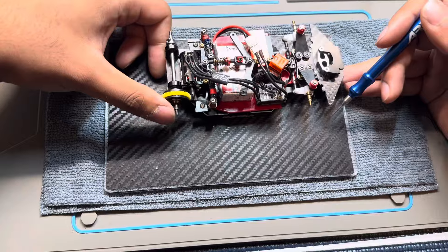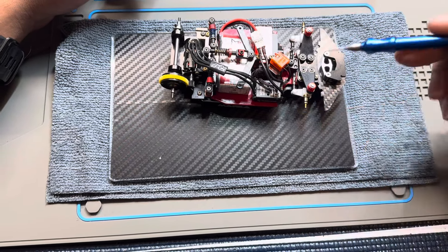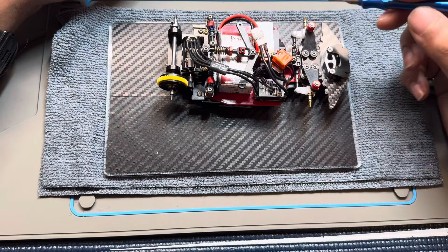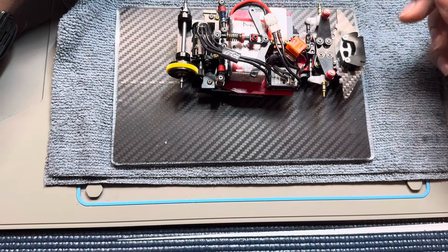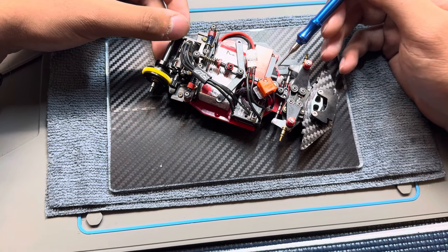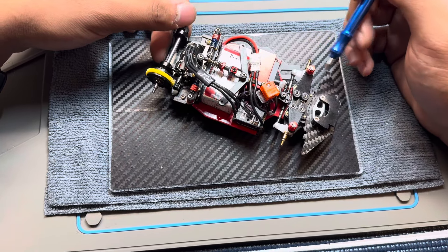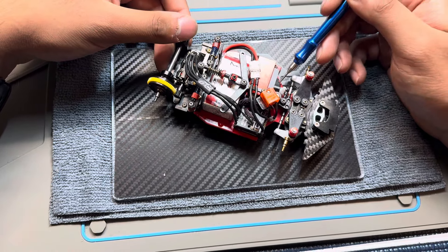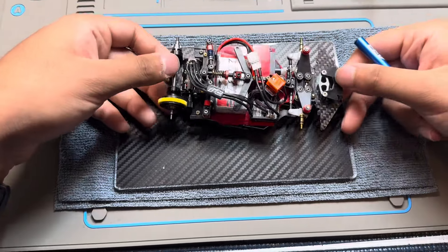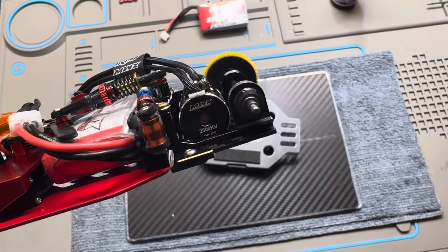The biggest thing about the Hobby MC is no Bluetooth, so I'm stuck constantly unplugging the cable and plugging in the programmer to adjust things like drive frequency. It is very fast to save settings, but not as quick as wireless. Since then I've had issues where the servo isn't returning to center — it kind of walks in directions sometimes, which is not good. But the new MWX servo is tuned with different software that pretty much guarantees it's going to find center every time.